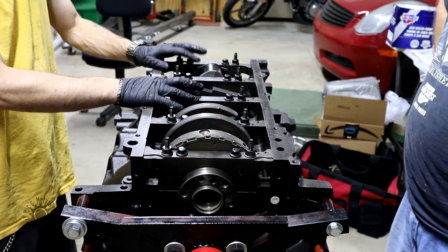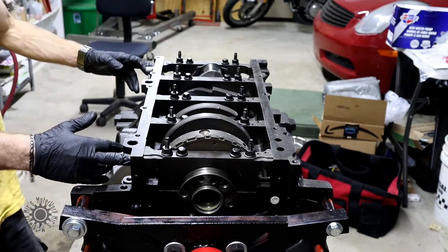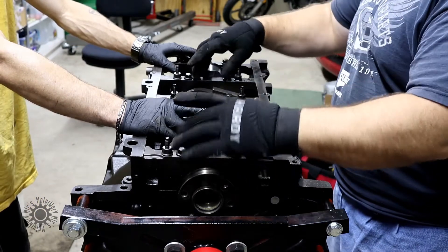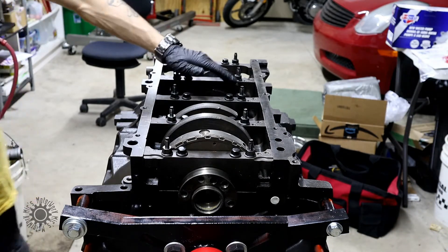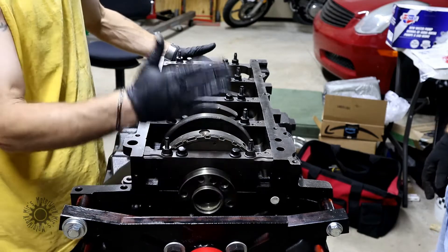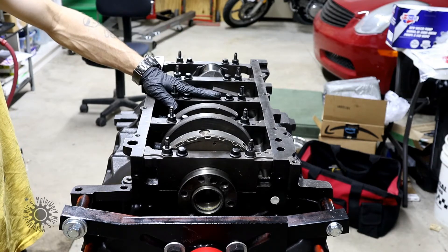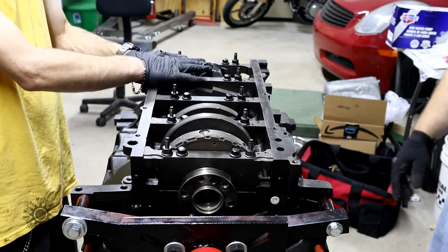The initial 15 foot-pounds is just to set everything in place and lock it down. Once you get the top side done, then you go into the side bolts and torque those to 18 foot-pounds, and then your bottom end is done. So to confirm the sequence: inners first — the sequence is 1, 2, 3, 4, 5, 6, 7, 8, 9, 10, just like the Mopar. Then tap the outsides with a rubber mallet to align that thrust washer. Then re-torque that same sequence 80 degrees. Then tighten the outer studs to 15 foot-pounds in the same sequence, then go 50 degrees on the stud side.